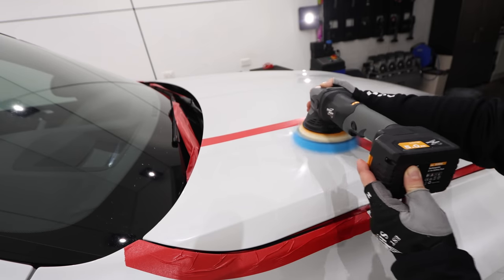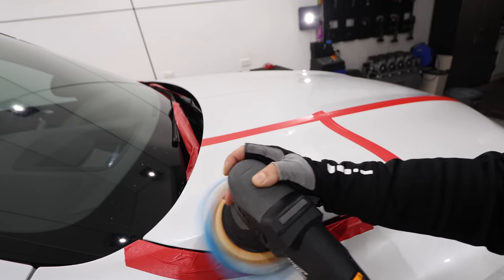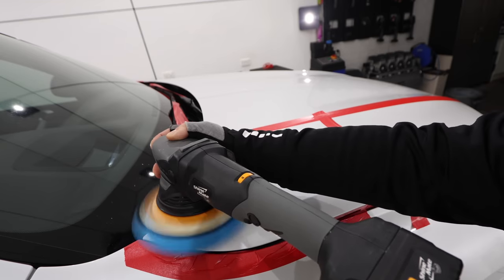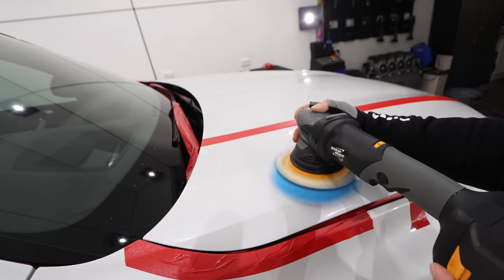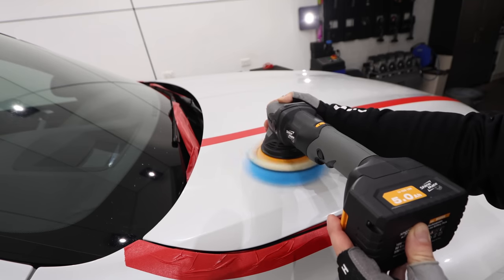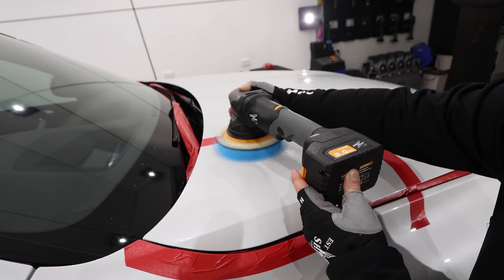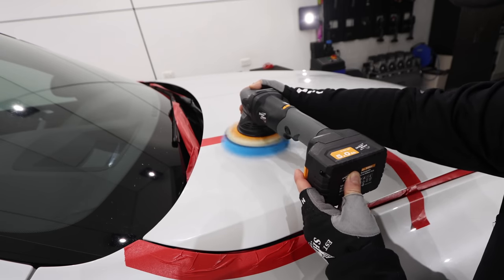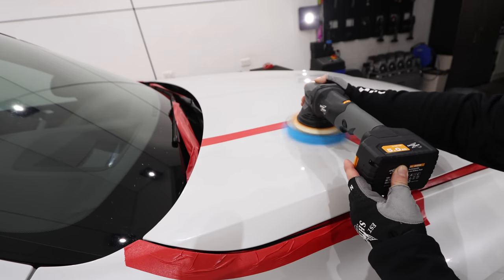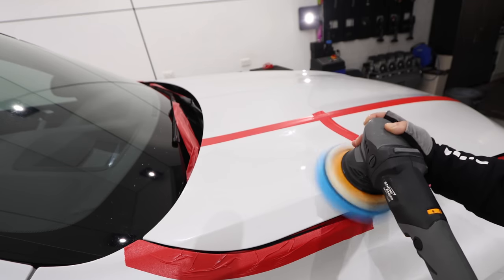So Morph, being a light to medium primer polish, won't really remove very much clear coat at all, and additionally it will fill in some minor defects and allow me to still apply a ceramic coating over it. As far as the ShineMate Blue pad goes, it's also a rather non-aggressive pad, but it's generally a fantastic one-step pad, especially on mid to harder paint types with light to moderate defects.